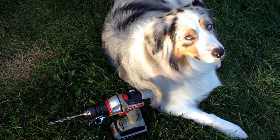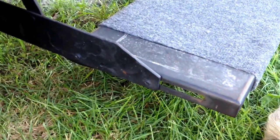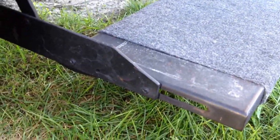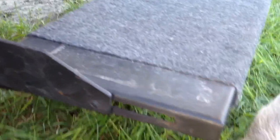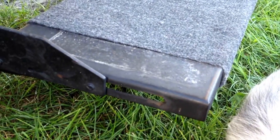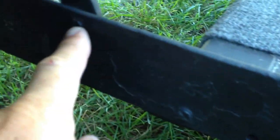Hey everyone, Coby and I are working on the 1992 Champion Euro Premier. The step had a little issue this weekend — someone almost fell off it and got hurt. The rivet in the back here, you can see where I've replaced that with a bolt. That rivet came out apparently on the retract cycle, and when we put the step down and he went to climb out of the RV, the step dropped on that corner almost to the ground and he went flying. Luckily we were on soft grass and he's a younger guy and didn't get hurt. So that got me looking at these and I noticed a lot of these little areas are rivets that come loose and they need to be watched and taken care of.